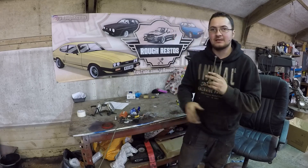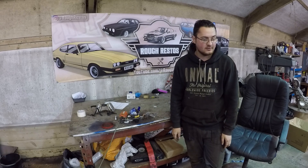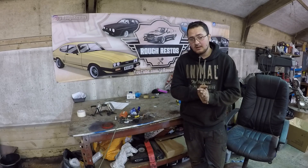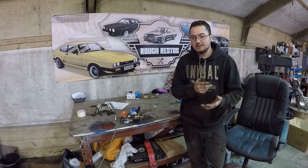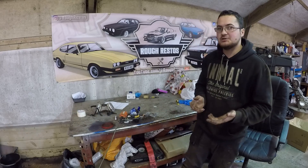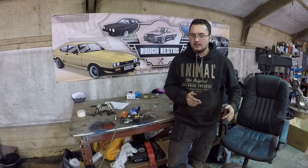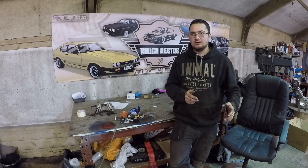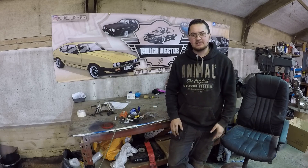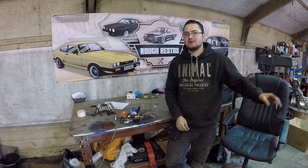That was one of five videos recorded on the L322 - a lot of work, more than I intended, but worth doing. The GAP iD procedure for bleeding the brakes seems a bit backwards - it makes you do the rear left caliper, then front left, then front right, rear right, and the ABS pump doesn't start kicking in until you get to the front right, then rear left, then it seems to do all sorts by itself. It's almost like the sequence is backwards.